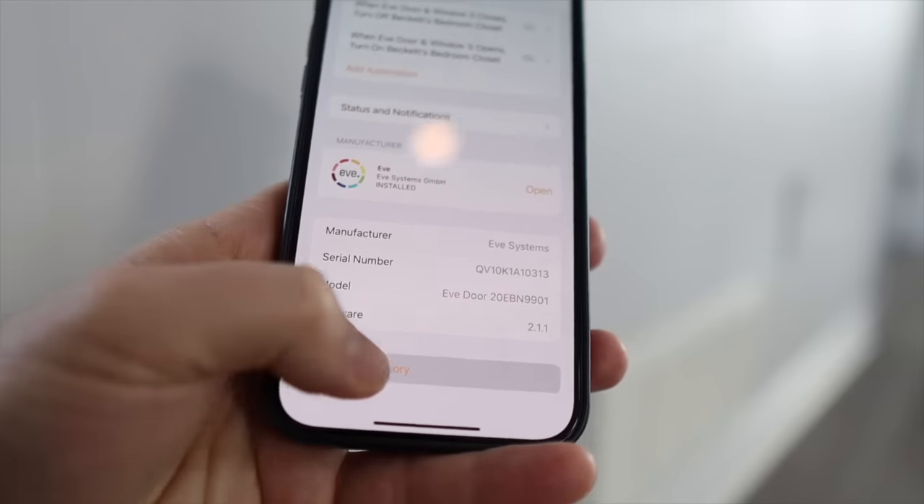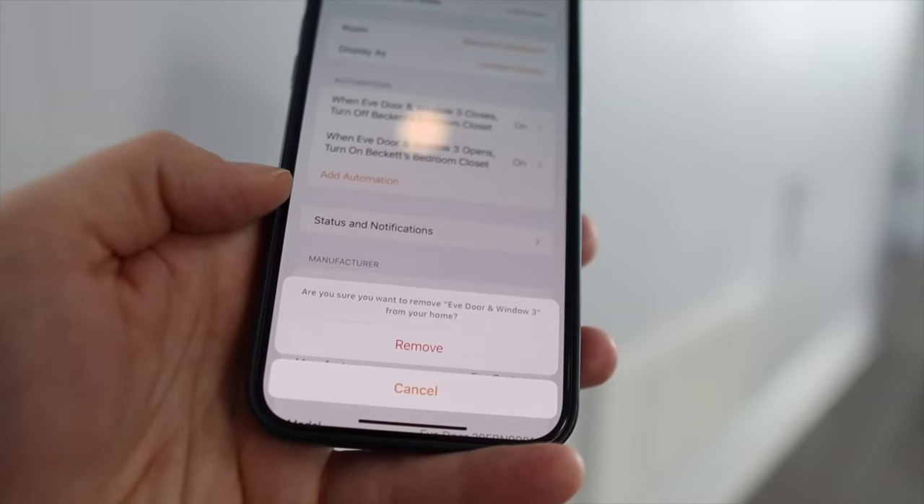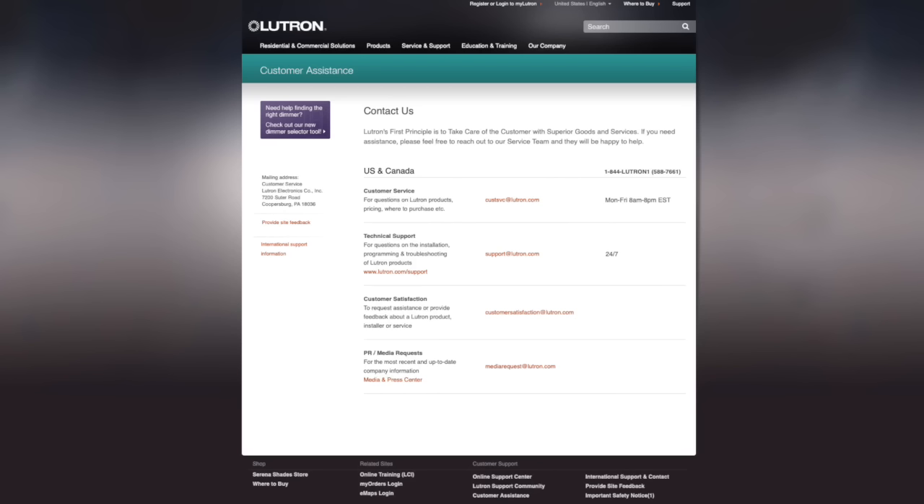Sometimes it's helpful to go into the third-party app and see if your device is working there. Perhaps there's also a firmware update that may help. Lastly, if it's still not working, delete the device from Apple Home, do a factory reset, and then re-add it. I hate resetting devices because it's time consuming and then you need to re-add all your scenes and automations — but just do it and you'll be glad you did. You can also reach out to the manufacturer, especially if it's within the warranty period, and do a Google search to see if it's a known issue. If others are experiencing something similar, there are sometimes suggestions there to try as well.